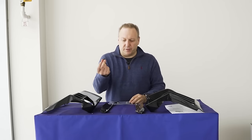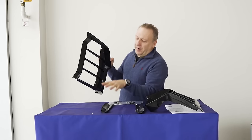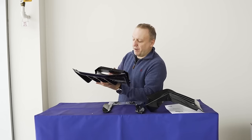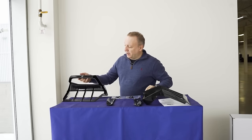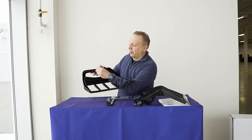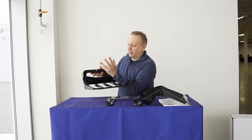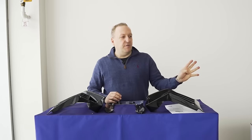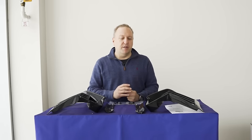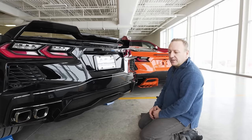We have T15 screws - two will go from the bottom of the diffuser into the mounting bracket - and two holes need to be drilled to the underpan. The upper point goes through the mesh, which is probably the hardest part of the installation. Make sure your car is cooled down so there's no exhaust heat, otherwise you'd burn your hand. You could technically do this on the ground with no jacking required if you have a proper drill. I'll be raising the car four or five inches to help the cameraman.